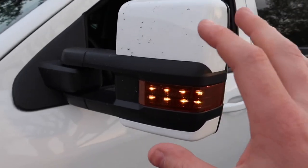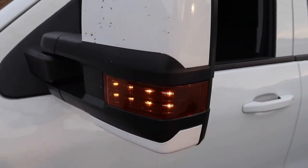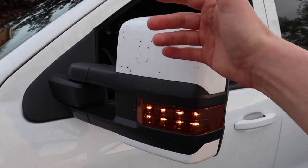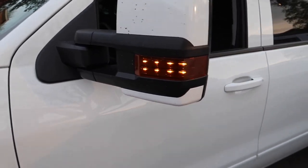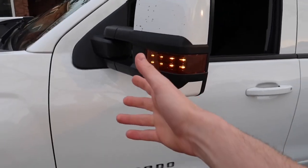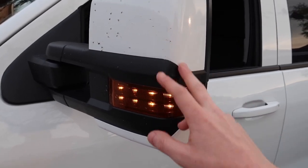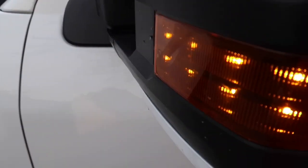This is the mirror here. I did go ahead and Plasti Dip this mirror and it turned out really well. I haven't used Plasti Dip in about nine years and thought I'd give it a shot. They came out with a product called Glossifier — I did at least four to five coats of white and probably three to four coats of the Glossifier on top. It gave it a pretty good shine — obviously not as high a shine as a 2K clear, but for something that's peelable, I think you guys would be more than happy.